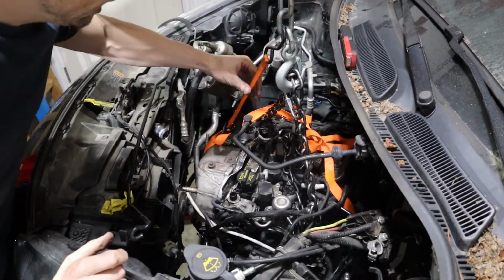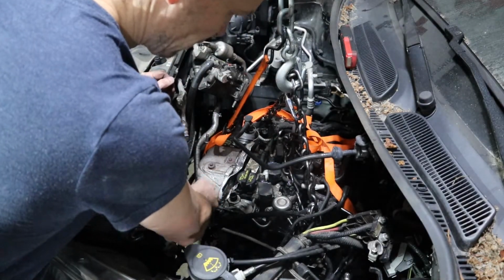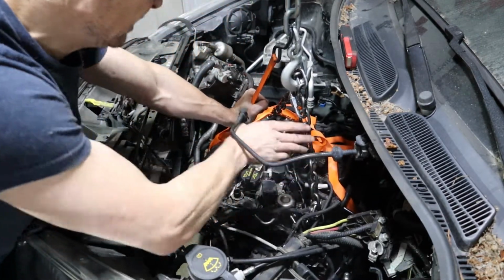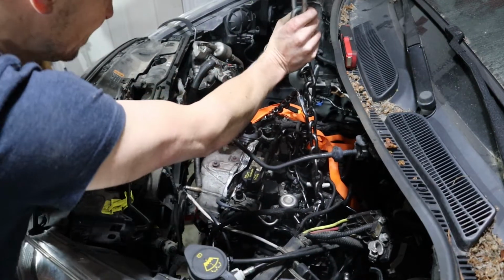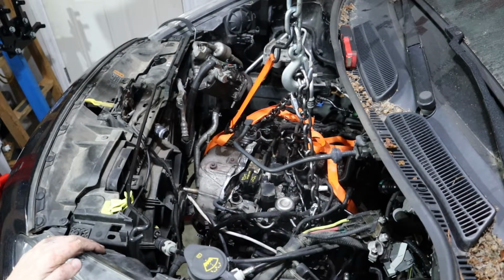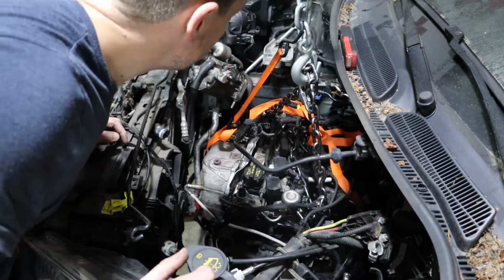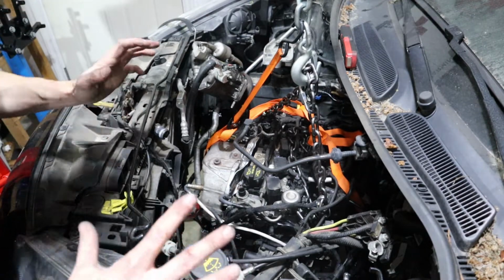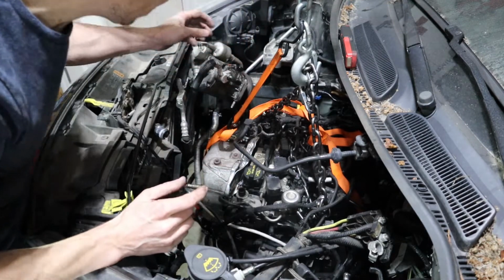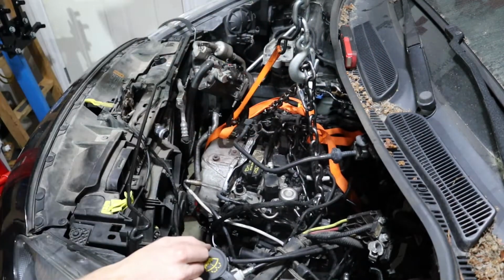Okay, I got this extra strap here now. It's actually pulling the front of the engine up. It was kind of leaning forward and I couldn't clear the stuff over in this end by the radiator. So I'm kind of jiggling and wiggling and lifting inch by inch. Kind of like pushing, kicking. And now I'm in a good spot where the transmission is over the leg of the crane, so I can now position this thing the way I want it. It is still awkward, but such is life.